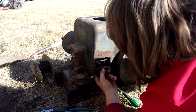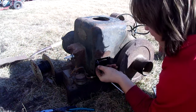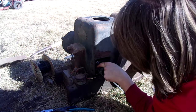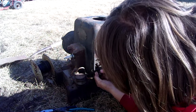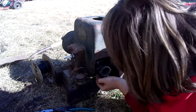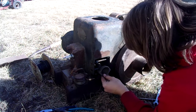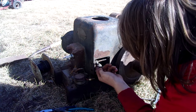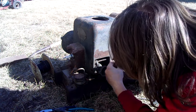So now it's holding it down, which is because I adjusted the governor shaft, which is right here. And this is clamped onto it, which hooks up to the throttle. I adjusted it so it was slower just in case that was a problem, that it was loose or something. And I learned that apparently when I was messing with it before, I popped it. There's a spot here that makes it pop past a certain point. And then I put it on idle, which makes it refuse to go to idle. So pop it past that, hold it there. Hopefully that'll not race off like crazy this time.